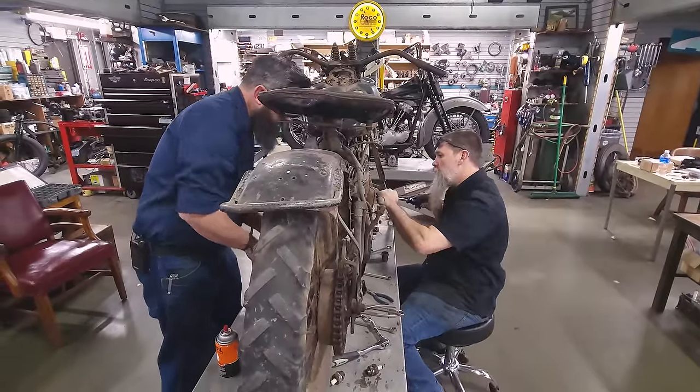I don't have a matchbook so I'm going to use my feeler gauge. Exhaust: six to eight thousandths — we're real close. I'll take it. There's our four. Okay, let's tighten these bad boys back up and keep them sealed. Then we're ready to bolt the head back on with the fresh gasket and do our compression test.